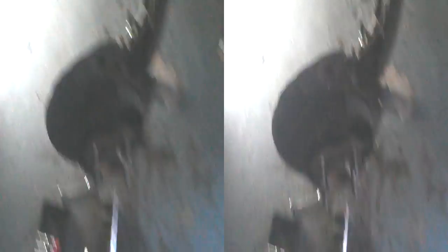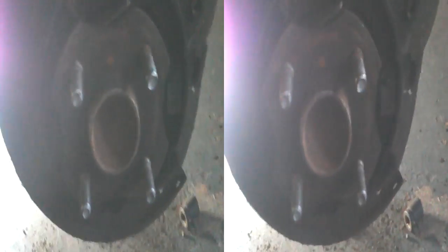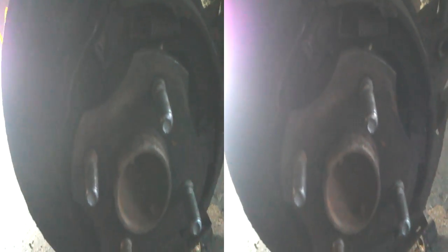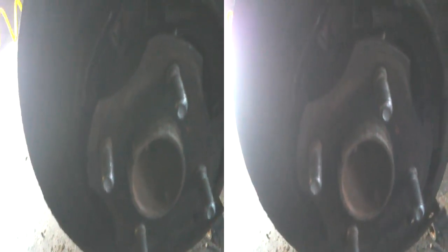We've got the back brakes and what it is is that the bearings are gone. I don't know if there's a scored or flat roller or something like that, but basically it just winds. We've got a worn bearing and it feels a bit sticky, I can feel it grating. If it's on both sides that's equal wear.